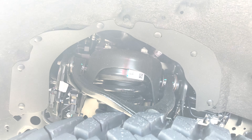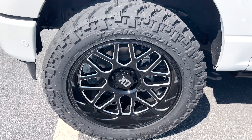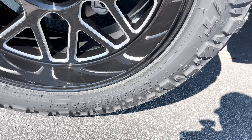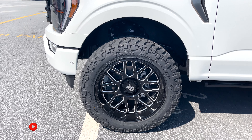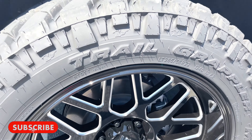We are leveled on 34.5 inches via a two-inch Ready Lift level kit up front — the hockey puck style right on top of your assembly. The trail grappler is a big gnarly tire that usually measures out taller than it actually is. The metric size is 285/55/22 on an amazing XD Grenade 2.